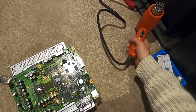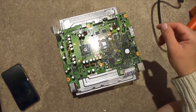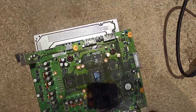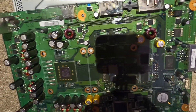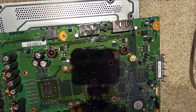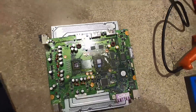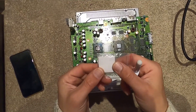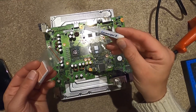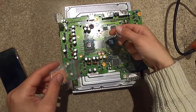Make sure you don't touch the top of that heat gun and make sure you don't lay it on anything that could light up. Everything looks good - it looks a lot drier. It's radiating heat. Four minutes is what most people online are doing. We're just going to let it cool back down to room temperature and then get ready to reapply our heat pads and ceramic thermal compound.